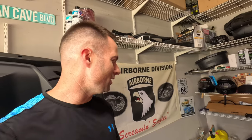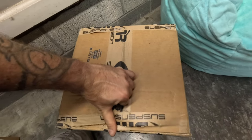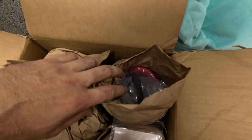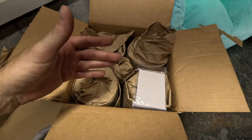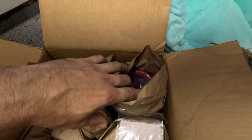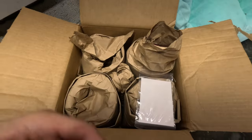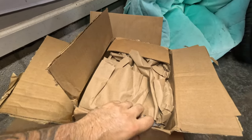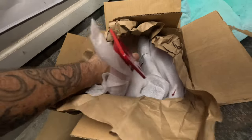We're not done — we have a bunch of other stuff. Let's unbox it all and briefly cover the install, because I know you guys care more about how it feels on the road. Just to keep everything the same brand — if we're swapping parts, let's just keep it all the same. Handling springs. Nothing wrong with the springs I had before, but stuff is designed to work together, like the sway bars. I decided to just do it all, and we get more adjustability this way. This is a linear rate handling spring designed to work with the sway bars and everything else, and it should be a similar ride height, but we shall see. We also have something that every single Mustang guy — whether you're road course, drag racing, it doesn't matter — if you've got a street car, you need this, and it's affordable. Cradle lockouts with the arms from BMR.